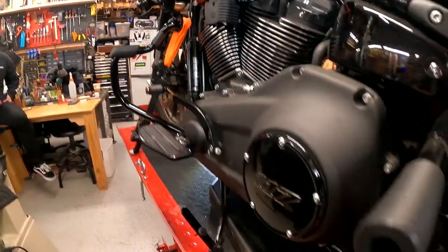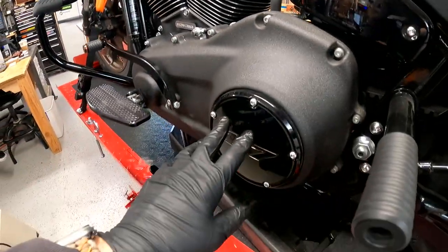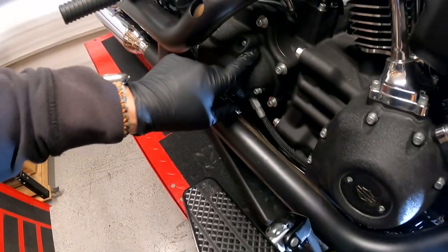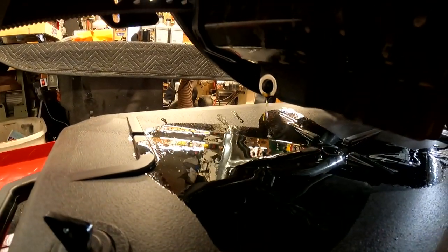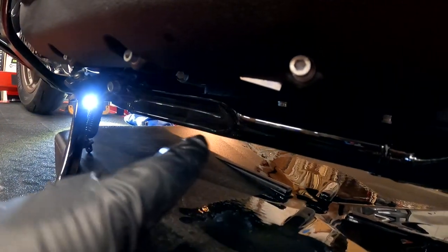There's three different chambers. You've got one place for engine oil, you've got your primary transfer case oil, and of course your transmission back here for oil. There's one right there — you can see that one dripping. And there's another one right up under here where this is dripping. And then the third one is under the actual transfer case, right here where this one's dripping.